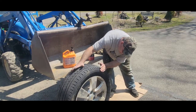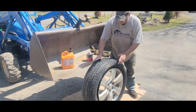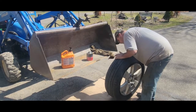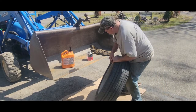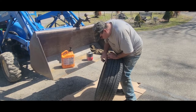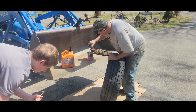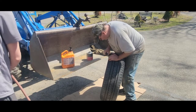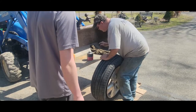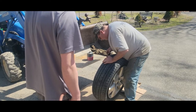If you want to grab the fitting we'll go ahead and put some air in this. Grab that tire chuck and we'll inflate it. This looks good — everything I can see on the rim looks coated pretty good. I don't want to see any shiny metal. What I always did when I suspected a rim of being pitted is I would have taken a brush wheel and run it on the rim to clean that up first — and that's what they obviously didn't do at Walmart.